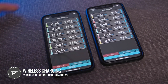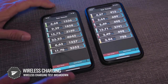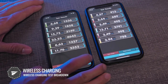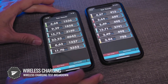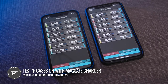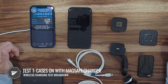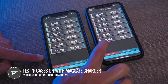Here are the test results. This is the iPhone 12, this is the iPhone 11 — the 11 has the everyday case, the 12 has the MagSafe case. The Amperes app measures watts and milliamps — higher numbers are better. First test: both phones on the MagSafe charger. The charger is rated at 15 watts, but I was getting 12 on the 12. Then on the iPhone 11, I was seeing only 3.94 watts — that's a massive, unexpected difference.